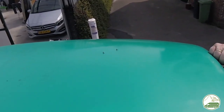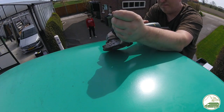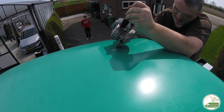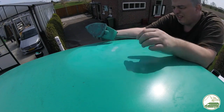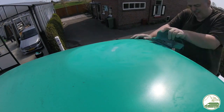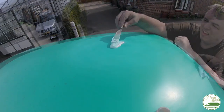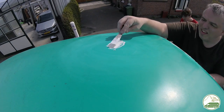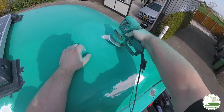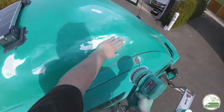There were also a few leftover projects we had forgotten about. One of those were two screws coming out of the roof after we built our bulkhead storage above the cabin — we had accidentally secured a beam to the roof using screws that were too long. Luckily these were stainless steel screws so no rust, but we still had to grind them down. Then we sand the area down, clean it and degrease it using slow-drying degreaser, and eventually apply car body filler to get the roof looking half decent again. After a few hours of curing we sand it down using the orbital sander.